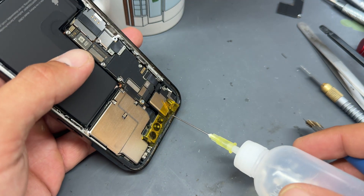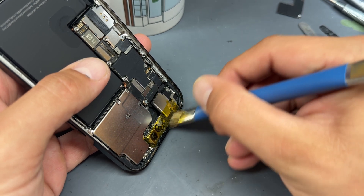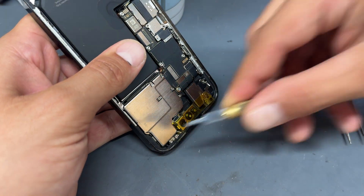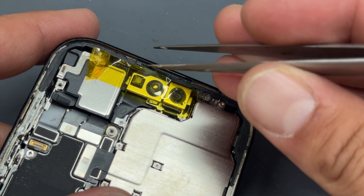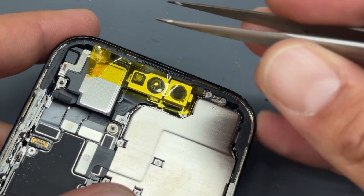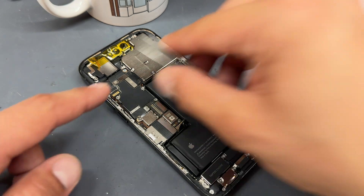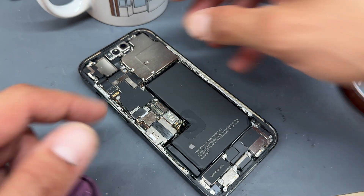For the top area, hold off on the acetone because there's a plastic ear mesh on there, so use isopropyl alcohol instead and catch up on any loose bits of adhesive. Be careful around the plastic mesh as it has a tendency to come out. Remove the little bit of protective Kapton tape, then make sure everything is sat down right.